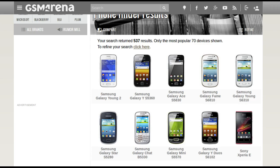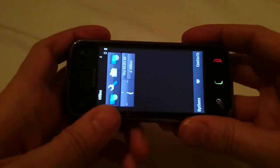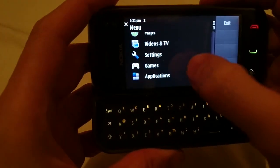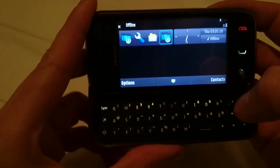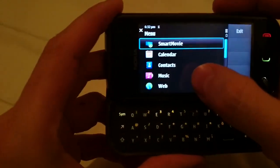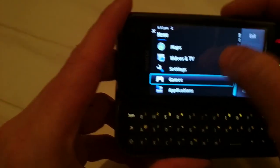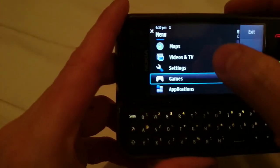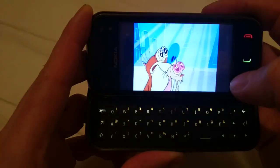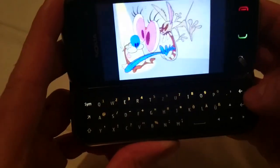I had to find a phone with a screen diagonal of 3.5 inches or 8.8 centimeters. I looked into small first-generation Android phones but they usually only had a resolution of 320x240, which is quite low for projection. But I found something else — this is a Nokia N97 Mini. It runs Symbian S60, one of the first phone operating systems ever, with a quite large software base and market leader for years before iOS and then Android took over. The phone has 8 gigabytes of storage, a micro SD slot, and micro USB for easy data access. The screen has a resolution of 640 by 360 pixels — not great but okay. The processor is a little slow but the phone was top of the line in 2009 when it came out. A software called Smart Video, which is not freeware, does a decent job playing video on this phone.